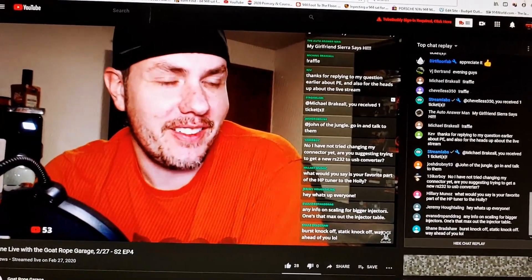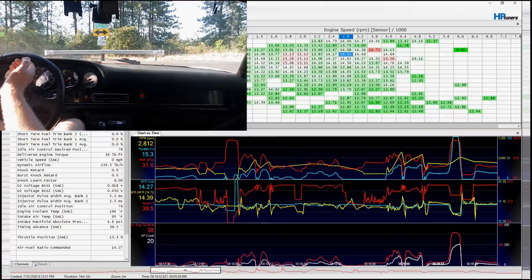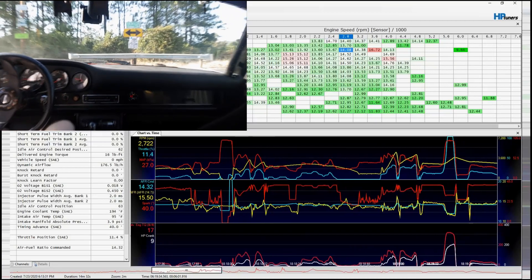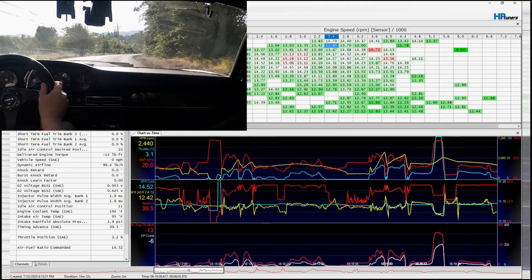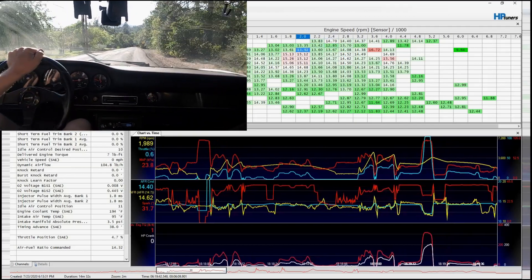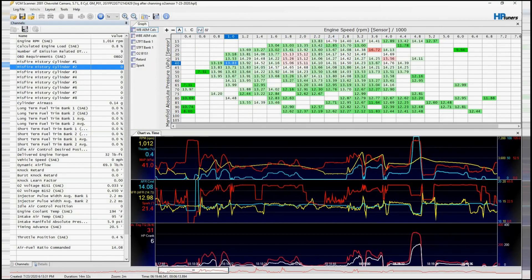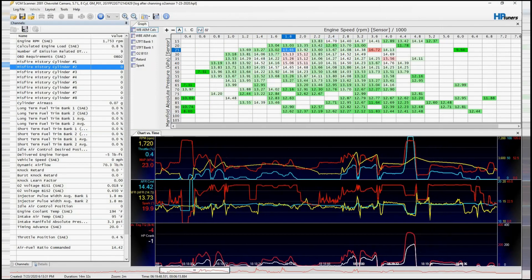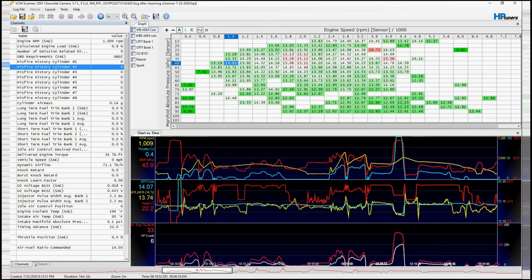One more thing on HP Tuners: since we're using a stock ECU, the transmission control can be done with a stock GM computer. If you swap transmissions, like going to a 4L80, you can usually find a copy of the code from another tune and just copy it over. There are other tuning software options out there, but they're usually more expensive or less capable than HP Tuners. Please comment below if you found something that works for you.